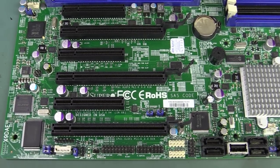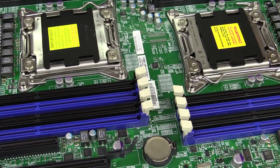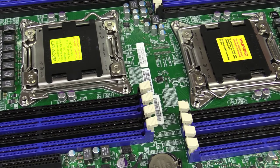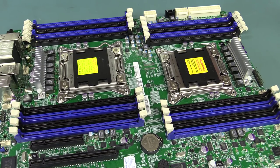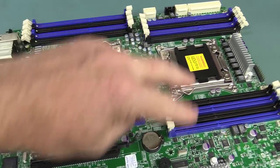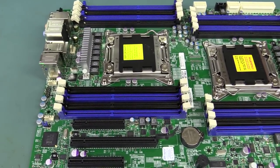Basically, as you can see, it's a dual Xeon processor — the E5-2600 series. They're Socket 2011 processors, and they're the ones I got in a previous mailbag. So I have two of those E5-2600 series processors — it should work a treat. But look at the amount of memory slots on this — it supports up to one terabyte of memory, apparently. I've only got like three regular server SIMMs, but I can pull more from the old dumpster servers. I don't know how many you have to populate — whether you need two in each channel or just one.